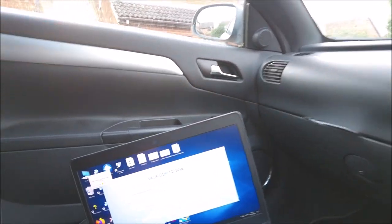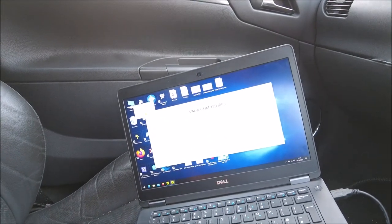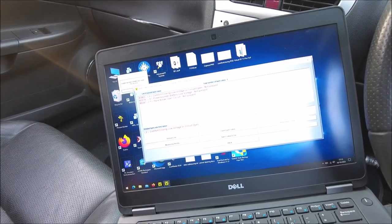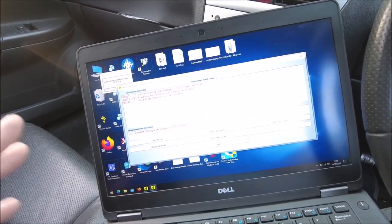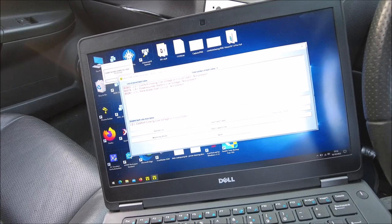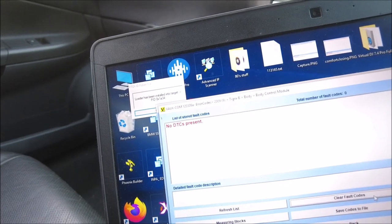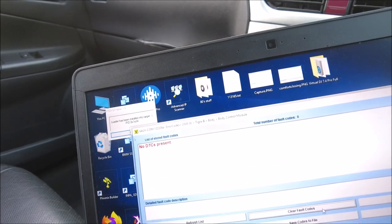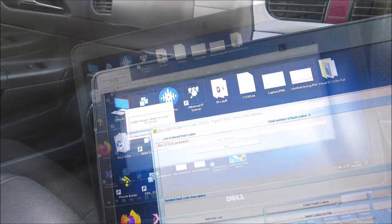It does want some work, but first of all let's do a diagnostics on it and see what comes up. I know there's an ABS light on - I suspect it's a sensor - but let's see what else is being flagged up. Nothing too concerning so far. Looks like it's had a low battery at some point, we've got comfort closing, power sound, and parking brake open circuit - all not present. I'm going to clear those and see if any come back, and they clear just fine. I suspected they would - just a load of little silly errors that will easily be cleared.